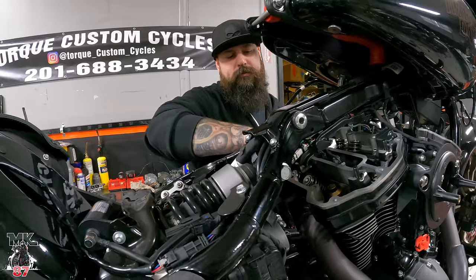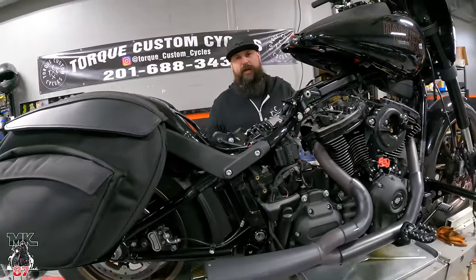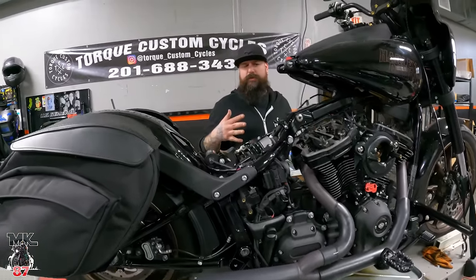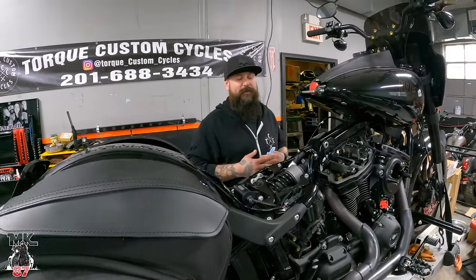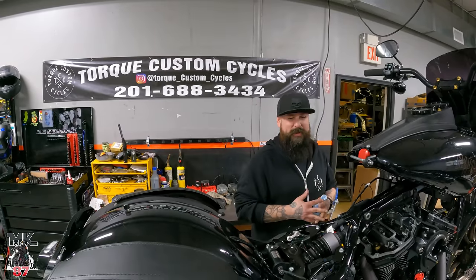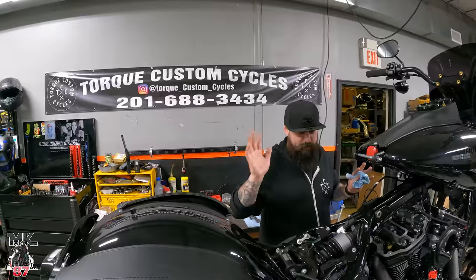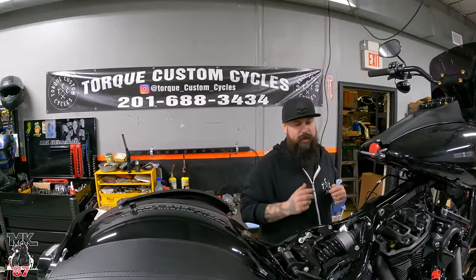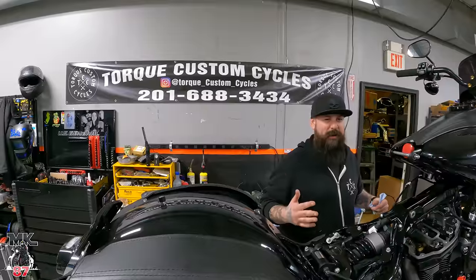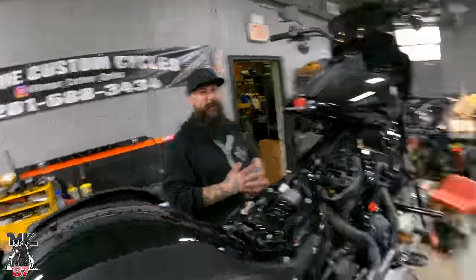We're changing out springs as well. It's the whole kit: your oil pump, your support plate. You're now hand choosing the pushrods and all that instead of just going for a straight-up kit. With the 508, you get more power. I still suggest doing the valve springs regardless of the size of the cam. Even though with 500 and up you should do it either way, if you went with a smaller one, I would still do the springs. You need your big bike to be faster than your small bike.